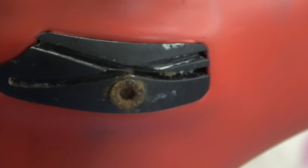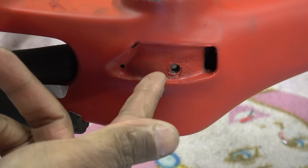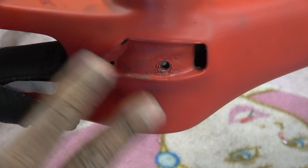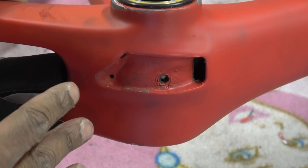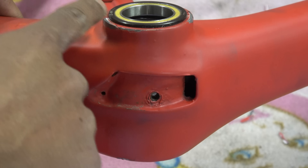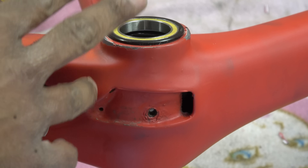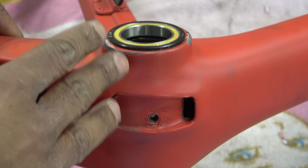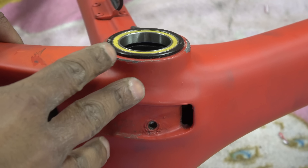There's the bottom of the frame — that is the gear cable guide. It's just scabby. I don't believe for one second this is an OE paint job. The next thing is I sprayed a bit of penetrating fluid on here and all the paint started to blister off. That's because this bottom bracket was originally BB386 and it's been repaired to make it BB86. So that's where the alarm bells start kicking in — and then the fact that the guy said he couldn't get it out.